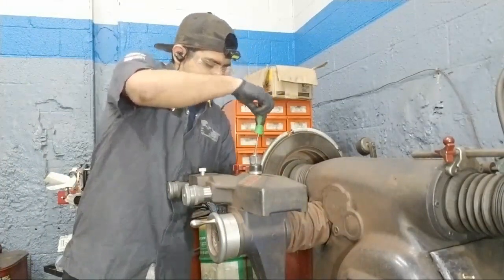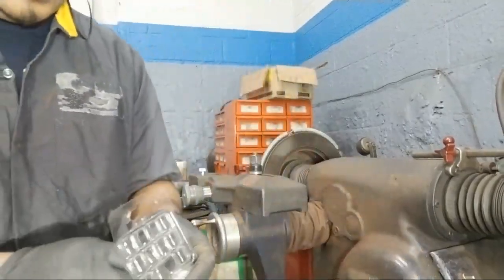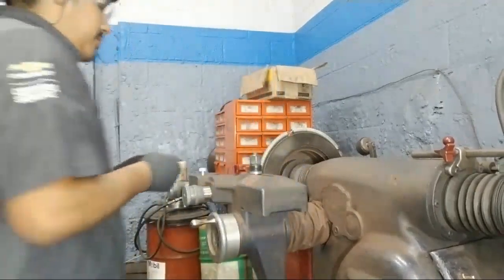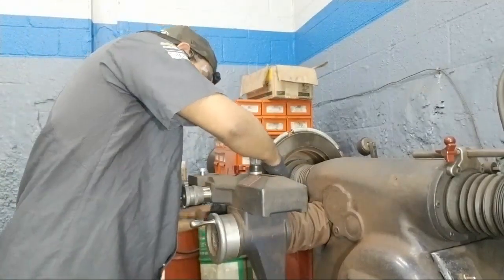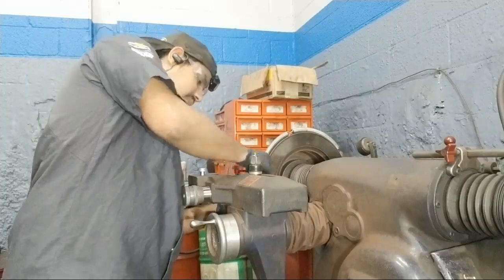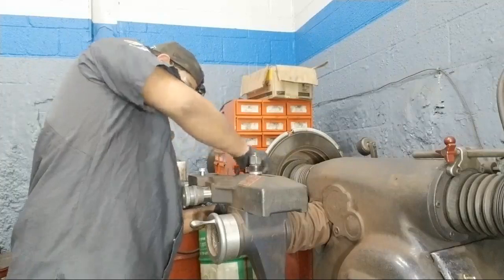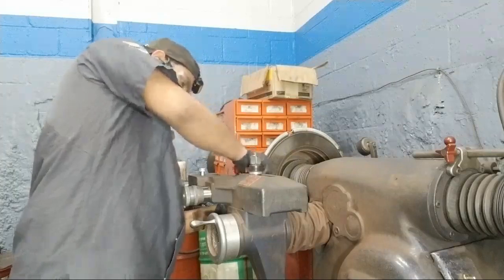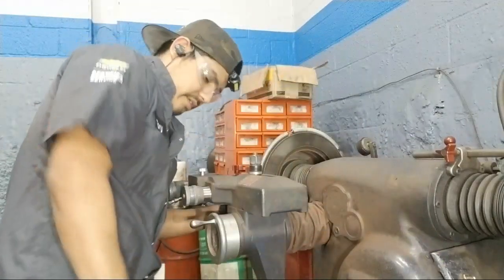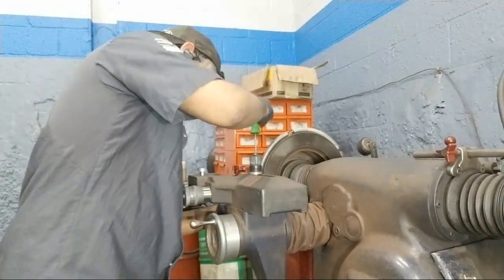The car has heavy pulsation. You can usually tell just by a visual inspection, though sometimes it'll give you a rough time when you're machining them. When you're applying the brake, you get that little kickback in the brake pedal, which is a good indication of rotor pulsation. A little annoying at times. This can be a cost-efficient repair. You can do it this way instead of replacing your entire rotor, but it depends on whether it's within spec or not.